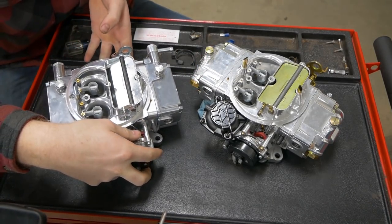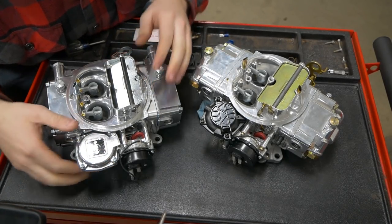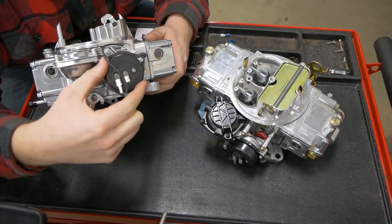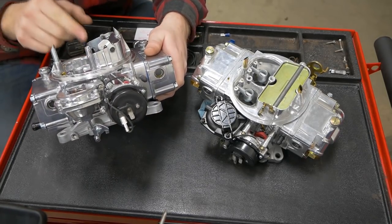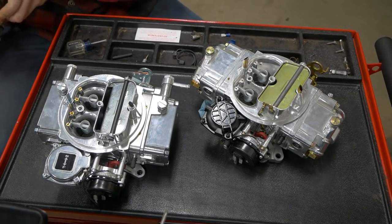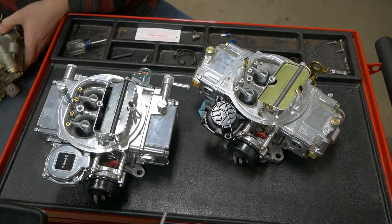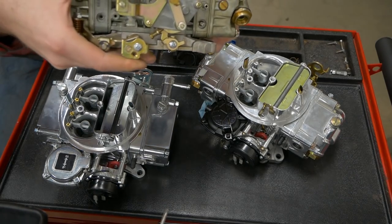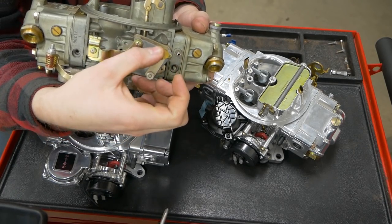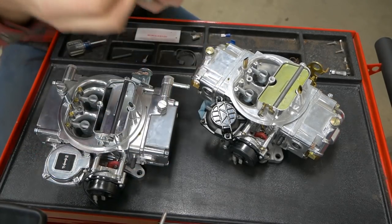These are both electric choke carburetors. Similar to secondaries there are two systems: electric and mechanical chokes. These run 12 volts to the choke. On all these chokes you can turn this barrel to adjust the amount of choke. You just turn this barrel to change how much or how high an RPM you want for your choke hold. There are also mechanical systems — just like your lawn mower, you just pull a lever inside the car and it changes the amount of choke you have. Simple enough.